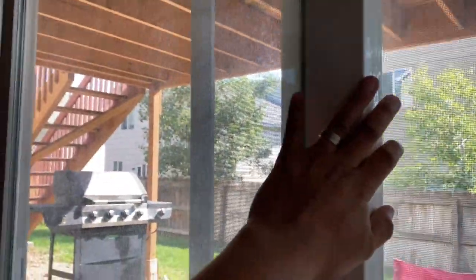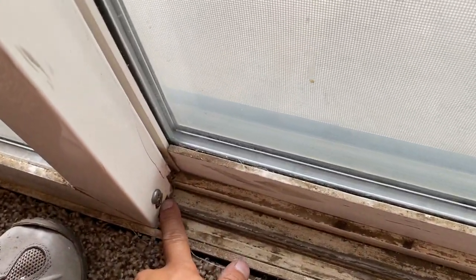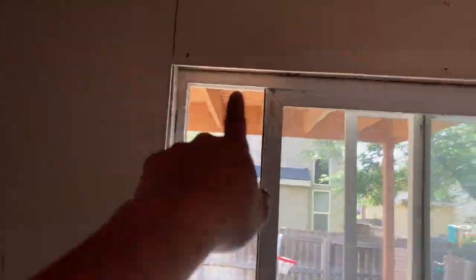What you need to do is tilt the door forward. So you close the door, there's a gap up top, and you tilt it forward. As you're tilting it forward, you're screwing it to the right — tightening it — so it can hold its place. If you tighten it almost all the way and it still does not fix the gap up top, move to the next step.